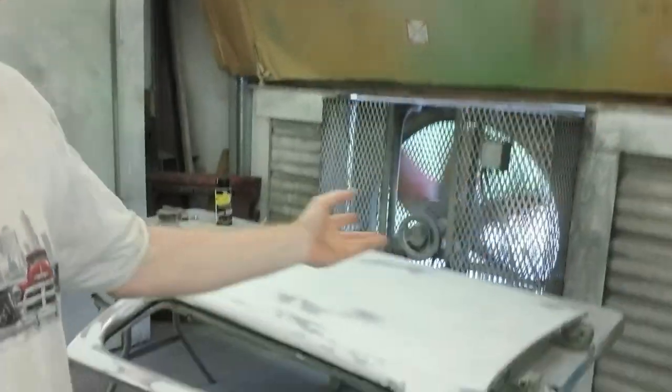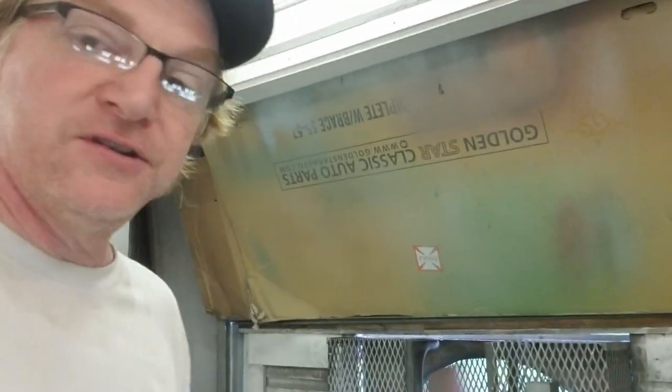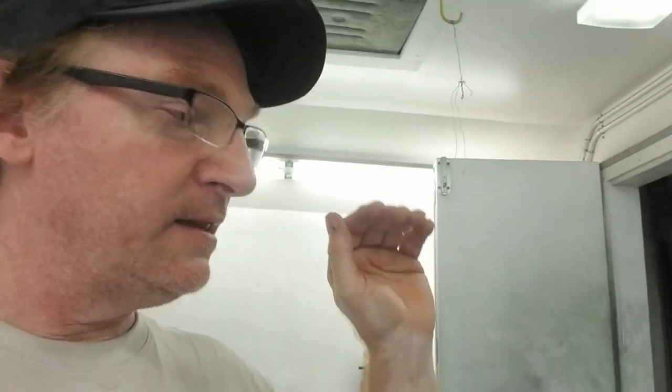Fun with Bondo. Whoa! I'm skim coating, building down. I hate freaking building down, but the doors, not the rock group, these doors, Eleanor's doors, they need a tiny skim coat to get all the whoop-de-doos. The doors are better than they ever were, but they're never going to be where we want them unless we reskin them, and that's the way it needs to be. On a budget, mm-mm. So we're just leveling with some platinum. After I get the platinum on, I'm going to 2K them, and I might even paint them and cook them out in the sun and let that stuff shrink wrap itself so I can go in and block them one more time, because to paint it twice, you make it really nice, and that's what I want.